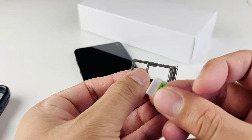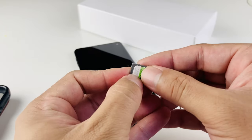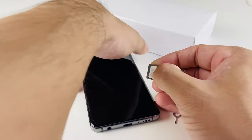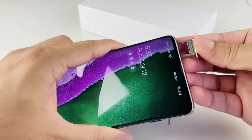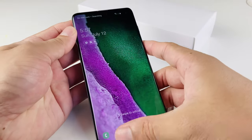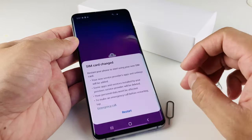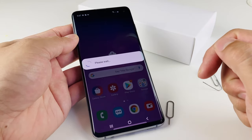You'll see I'm going to match up that cut edge with this piece right here and it will be flushed against this. Nice and gentle, flush it against it and then go ahead and insert it back in there. Once it's inserted back in, you have to give it 10 to 15 seconds for it to start reading the service and you should be able to get phone service. It might also ask you to restart the phone — in that case, hit that restart button.